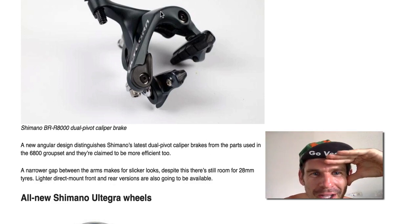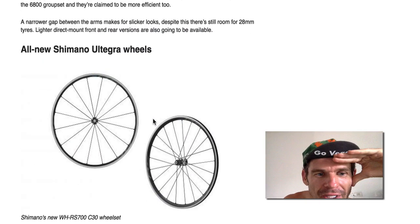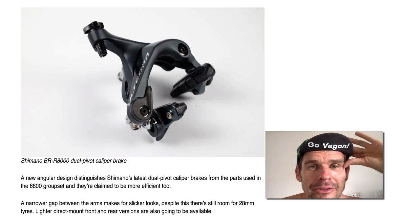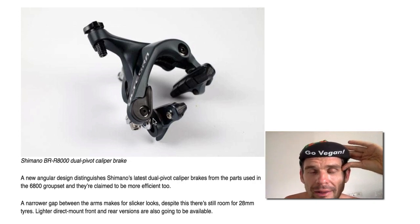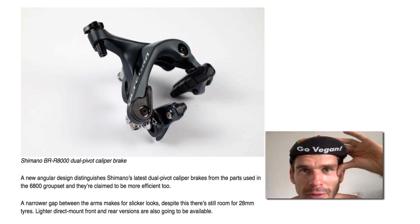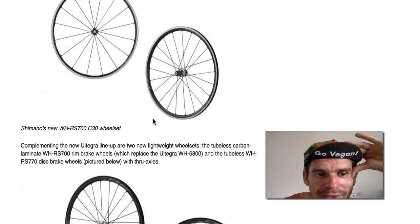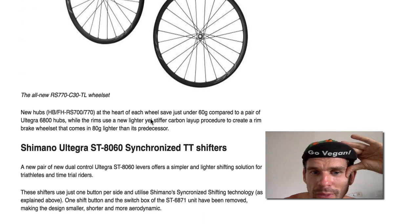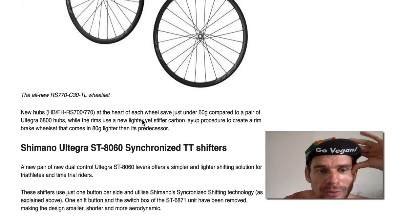What is cool here — they've got 28mm tyres will fit officially. So that's good, we've got a bit more clearance there, because the old Ultegra didn't have the tyre clearance that the 5800 brakes did. The 5800 brakes, in my opinion, are currently the best brakes Shimano make on the market — better than the Dura-Ace, better than Ultegra, because it fits the fat tyres. I'm not even sure if the Dura-Ace fits the fat tyres, because Team BMC was running 105 brakes in Paris-Roubaix this year for the win.